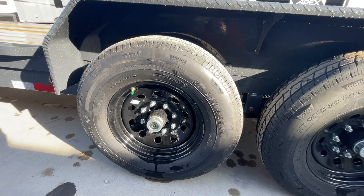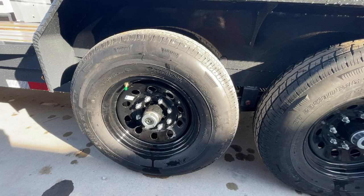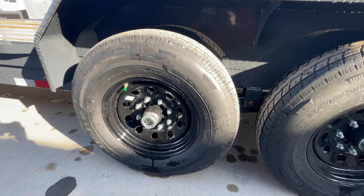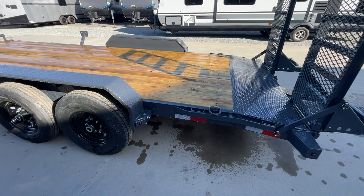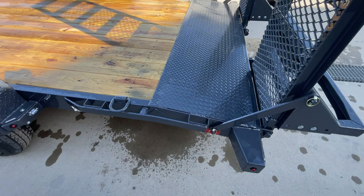This also has the newer forward-adjusting brakes. If you're not familiar, they will self-tension similar to an automobile throughout the life of the pad — very little maintenance required. It's also got 235 80R16 load range E 10-ply radial tires. Take 80 pounds of air and 90 to 120 foot-pounds of torque whenever you re-torque your wheels.